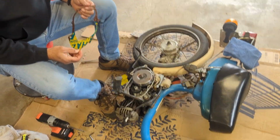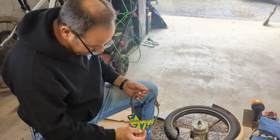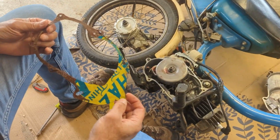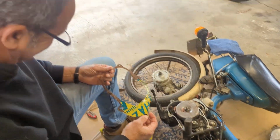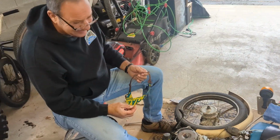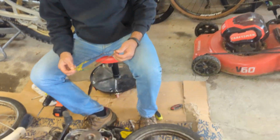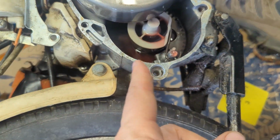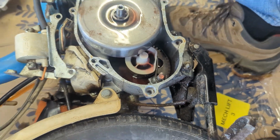All right, so we've got the QT50 on the side. Dad is holding my makeshift gasket that got us through Vintage Days last year on the QT. What do you think, Dad? I think it was time for a change. It's time to replace it with a legit Yamaha gasket. Yep. So now we've got an OE one going back on. But first, this thing has been stripped ever since I've had the QT, so we are going to helicoil that thing so she seals up nice and tight.